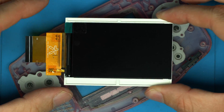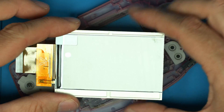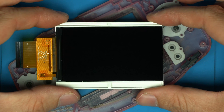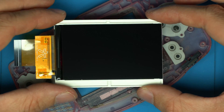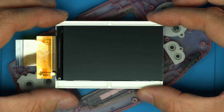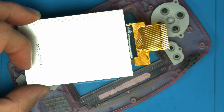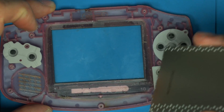So we've got the TFT here — this is our clean screen TFT, which we have made ourselves. That's taken over a year to produce. It's got a protective film on, so just peel this off. You can see already the screen has a lovely matte finish, which means it doesn't reflect as much light and gives much better color reproduction. It's also got a protective reinforcement strip right where the delicate part of the screen is, which is common on many other screen kits where you'll rip ribbons. We've actually embedded a reinforcement strip to prevent that.